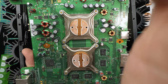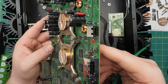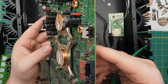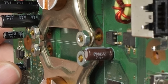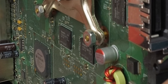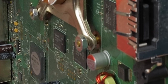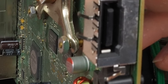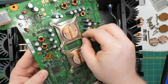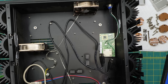With the board now out of the case, I remember thinking when I first looked at this thing that the X-shaped brackets looked exactly like Socket 775 Intel coolers they'd torn apart, and this was confirmed by one of the employees I spoke to. I found it remarkable that those just happened to fit the Xbox 360 motherboard — but it turns out they didn't. Niveus ground down the legs of the brackets and then used a drill press to add new holes. This would almost be a good idea, except the legs aren't flat. Intel stamped ridges into the legs to make them stiffer, and Niveus did nothing to flatten those, so the nuts are sitting on rounded surfaces, almost certainly applying very uneven pressure to the chips. At least one of these was just spinning in place, doing nothing at all. This is truly awful workmanship — it's worse than what you'd typically see on a beginner case mod project.